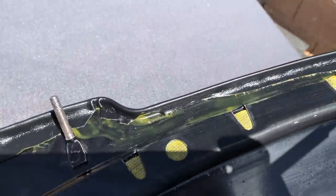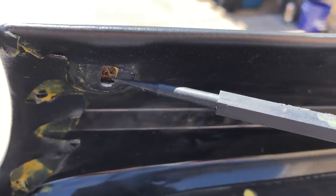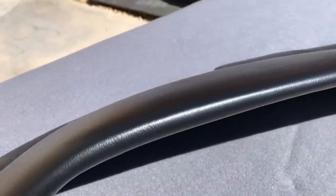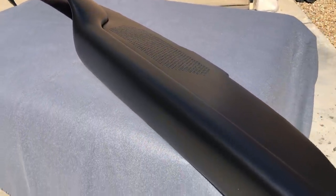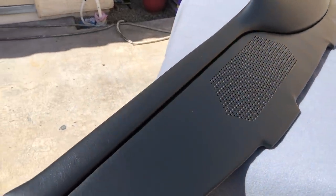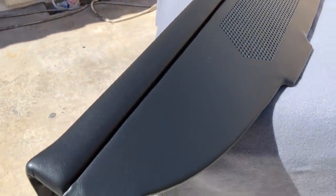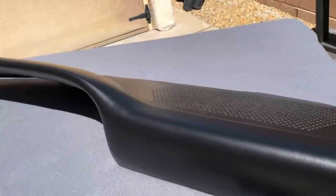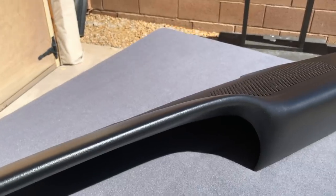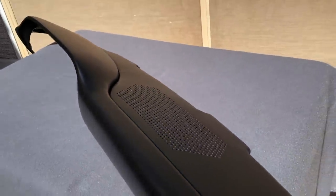That's what our bottom glue line is going to look like. Installing is really not too bad — there are just two studs, one here and one here, that go through the back of the dashboard, and some push-in style clips along the front. A final look out here in the sun. If you decide to take on the dashboard yourself, I wish you the best of luck. I'm going to say the degree of difficulty restoring this dashboard is a 10 — incredible amount of work. The more padding you put on, the more forgiving it'll be, but the more you get away from the original detail and beauty. You can find everything you need in the video description box below — links to all suppliers, all supplies, and also a link to this really cool template by Daryl's Garage. A really big thanks to Daryl for the help on that one.